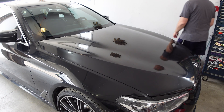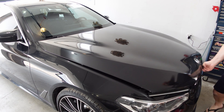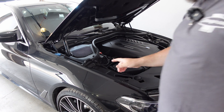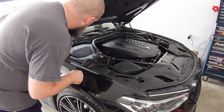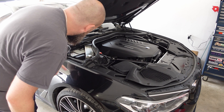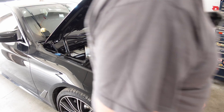So you get to the front, you're going to reach inside, pop the hood, confirm that your power is out. What we're going to do on the 540 to play it safe is you have a secondary auxiliary battery right here. My understanding is this one's a lithium battery. So just to play it safe, we're going to take the cover off this one, put it to the side, and again disconnect the negative, which would be this one farther over there. So 10 mil wrench, and we're going to put a little towel up and over top of the connector.